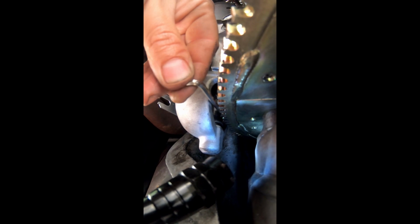All right, what you want to do is check with your 1/8 inch socket, Allen wrench or bit, and just set it in between the teeth and the shaft. Mine's in there, and it's barely off. I've got just the hair of play in this thing. I'm going to go ahead and leave it like that, crank it up and see what it does.